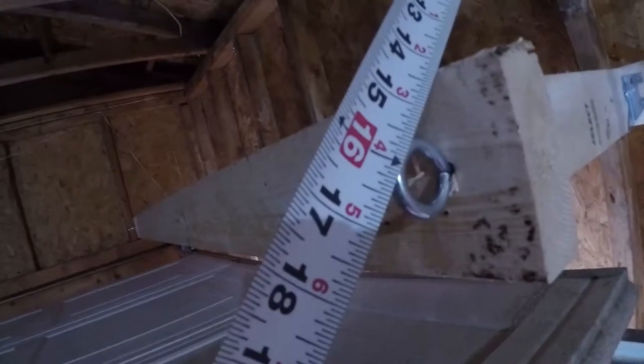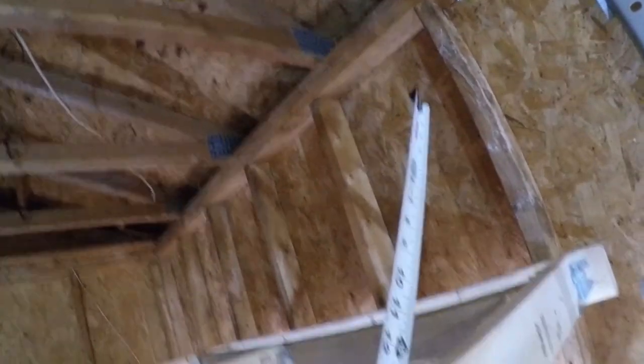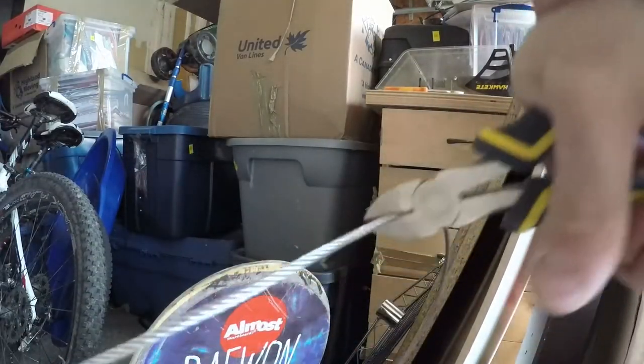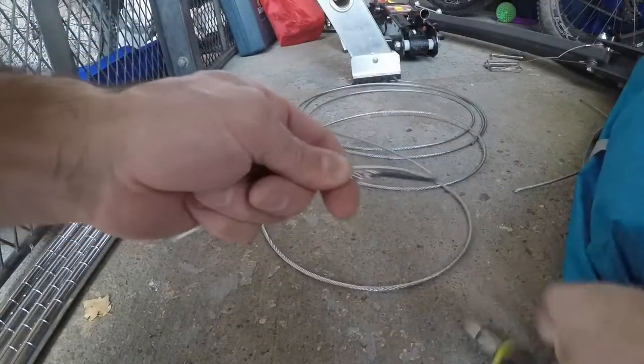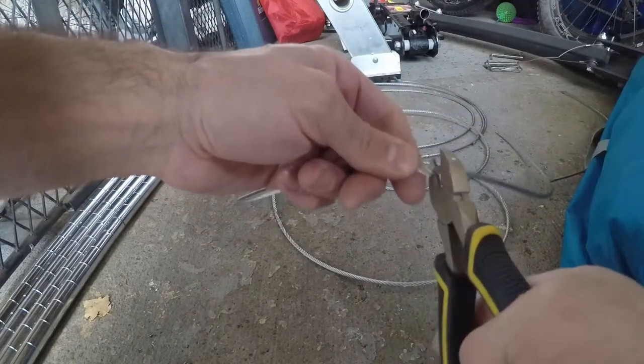This will prevent the front end of the tire rack from drooping down. Now I'm going to measure off my steel wire rope — essentially I'm going to make two loops, so I'm cutting my first one at 18 inches. These side cutters are not the thing to use; if you've got something bigger you're definitely going to want to use that. However, I do get through it eventually. I'm going to cut two loops per side, so I'll cut the first two at 18 inches. I do own bolt cutters — I just can't find them.